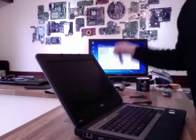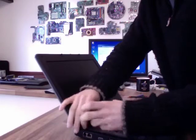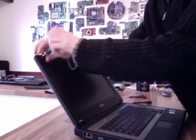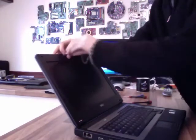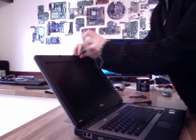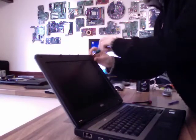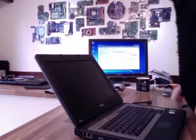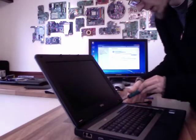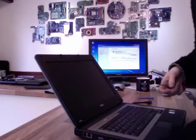Okay, right. I'll use my #1 screwdriver just to undo these screws. Normally I'm a bit apt with a screwdriver, but I'm doing this cack-handed so I don't cover what I'm doing from the camera. One more. This one's got the glue still stuck on it. I'm just digging my screwdriver straight into that so I don't disturb the sticky pad on the screw, and then that will just stay on there, so when you reassemble you don't have to replace the glue.